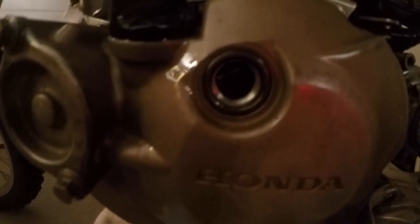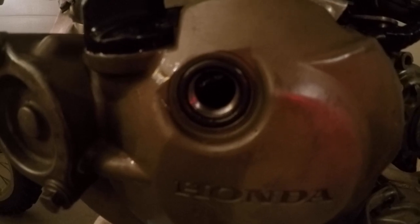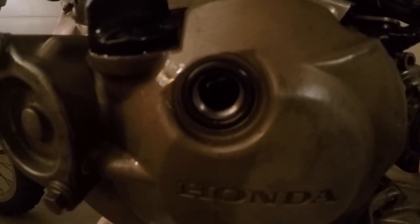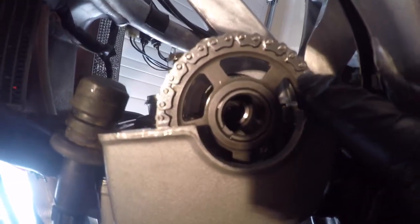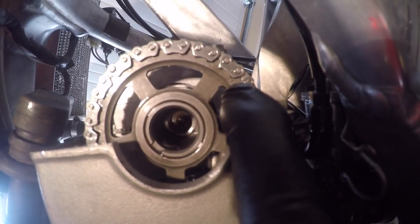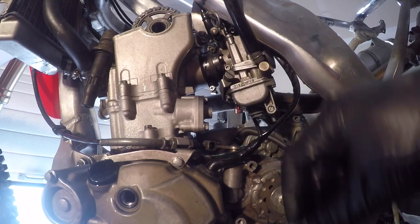Then go to the left side of the bike — note it's possible to be 180 degrees out. On this side, look at the flywheel and you'll see two little tick marks on the flywheel; those have to be visible. It is possible to be 180 degrees out. Then go to the actual cam itself. As you can see I have this purposely set wrong — there's one tick mark I'm pointing to and it's on the exact opposite side of the wheel, not visible right now.